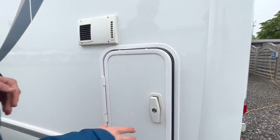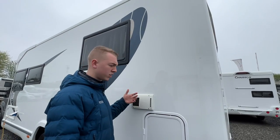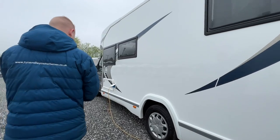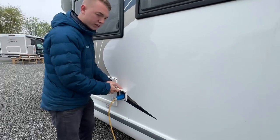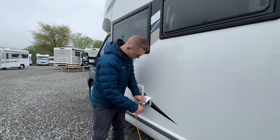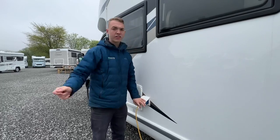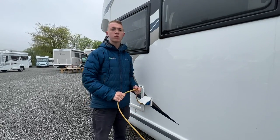There's a smaller door into the garage and a vent for your heating system to allow fumes out when operating. This is your hookup point — whether charging the van at home prior to going away or on a site. Lift the collar and always hook the van up first then the site, and do it in reverse order when unhooking, so you're never walking around with a live lead.